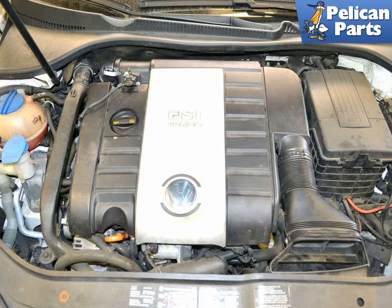You are going to be supporting the engine while replacing the mounts. Never remove both mounts at the same time while supporting the engine with only a floor jack. Also, all the hardware are stretch bolts and considered single use only. Always replace them.